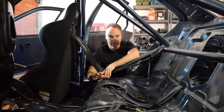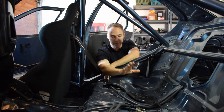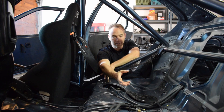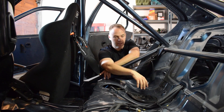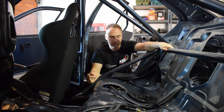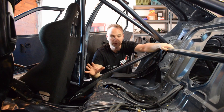The original tank is nicely situated for weight distribution, it's plastic, and has a lot of benefits. If you want to run fuel lines through the car, the rules dictate that the lines must be covered and protected. So I'm going to have to build a cover and a routing shell for the fuel lines. I'm going to get my fabricator, RSI Fabrication, to help with that because it's a very complex structure — we'll build it out of aluminium. I've seen carbon fibre setups; it's quite common in Polos, but this isn't a Polo and there's no off-the-shelf solution, so we'll manufacture something that's also visually appealing.